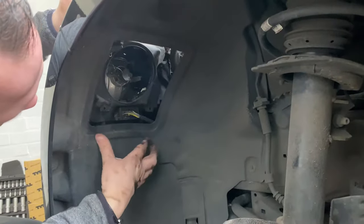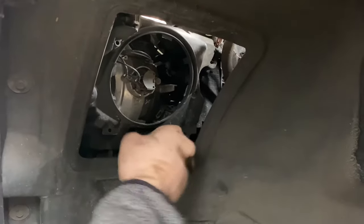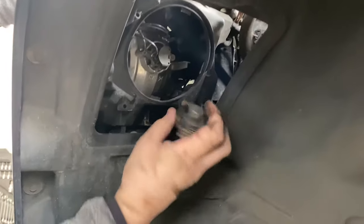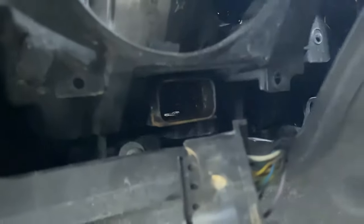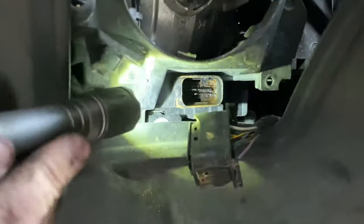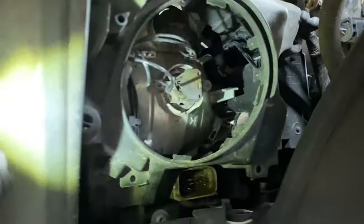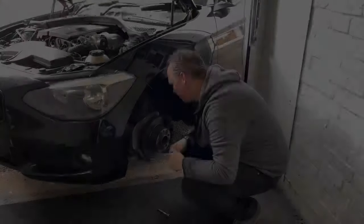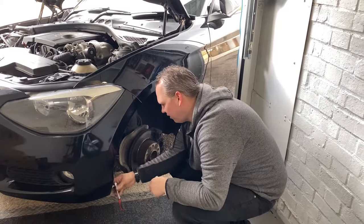What's happened is — let me get out of the way — the guy was missing a plastic cover here, which we have here as the replacement. The water has got in, damaged the cable — wow, that is corroded — and the socket still has water in it, see? So it was a cheap and easy mistake: he's missing the headlight access panel cover. We have nine 8mm bolts all the way around the wheel arch cover to remove.